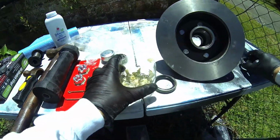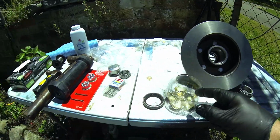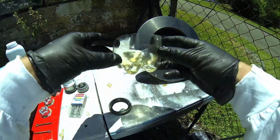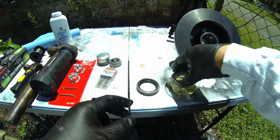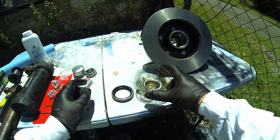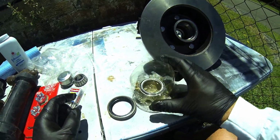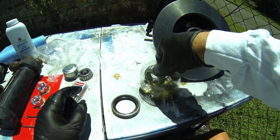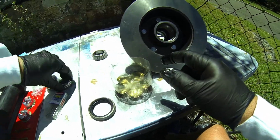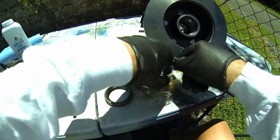Okay, we're going to be setting up the bearings right now. First things first, get a little bit of petrol inside a little cut-off bottle or something like that, as you can see what I've done over there. Just wash them off inside, give them a little run around. It takes off any factory chemicals or anything else inside the bearing, just to make sure it's ready to take on grease. And then all you've got to do is leave it in the sun. I'll do the front bearing as well, and just roll it around in there, nice and easy.